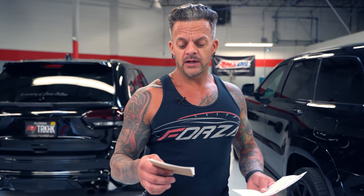Next up: Stage 4R Trackhawk with just the upgraded heat exchanger. Run 1 started at 115°F and ended at 151°F at 87 mph. Run 2: 122°F to 156°F. Run 3: 126°F to 160°F. Across all runs that's a gain of 34 to 36 degrees — compared to 43 to 45 degrees on the Demon Hawk — but crucially it starts at a lower temperature each time.